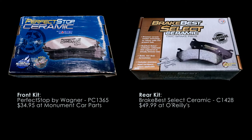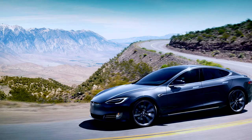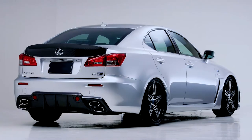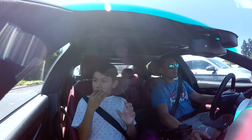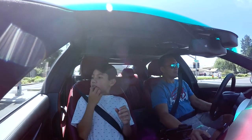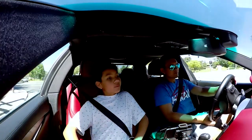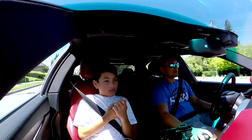These kits do not have the brake sensor, but that's okay because you can disconnect them without warning lights popping up on your dash. You're probably asking how good are these pads — the rears are the same ones used for the Tesla Model S and the fronts are used for the Lexus ISF. I've already driven around 3,000 miles on these replacement pads and they brake just fine. I've had a couple of hard braking events and they clamp down and stop the car easily. They also make a lot less brake dust than the Brembo pads, so I like them a lot.